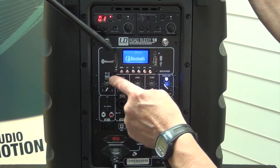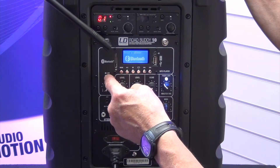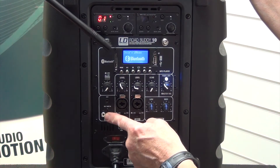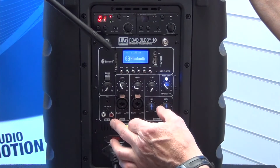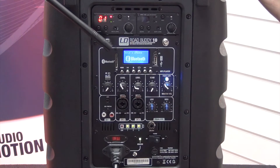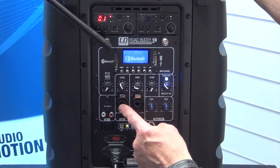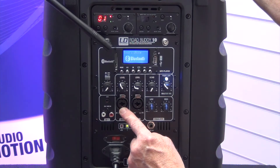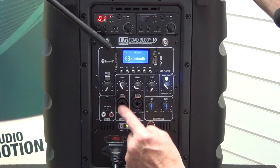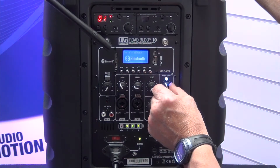When you're on MP3 mode, you select it with the little select button here, which you can pull out — that's the out position for MP3. When it's depressed in, it's on auxiliary. The auxiliary volume control goes via the mono-summed phono sockets — phono plugs left and right, but it mono-sums internally so you get both signals going to the speaker. This also applies to the 3.5mm stereo jack. For other devices like guitars or line level inputs, these microphone inputs are dual-purpose on jack or 3-pin XLR, with a line or microphone input switch, so you can attenuate the input on these two microphone or line channels. There is also echo on it, which I'll demonstrate now.